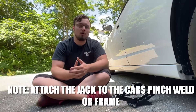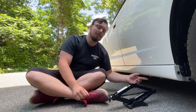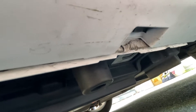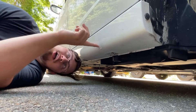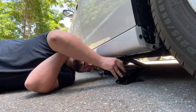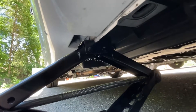A lot of trucks, larger cars, and older cars will have frames and you'll want to get the jack under the frame. But I'll show you the pinch weld on this car right now. A lot of cars will also have an arrow on the side pointing to where the lifting point is. The pinch weld runs along the entire edge of the car, but right here specifically is where the car wants you to put the jack. So now I'll slide the jack in under the car and line it up with that lifting point, then twist the nut to the right until it's touching the pinch weld.